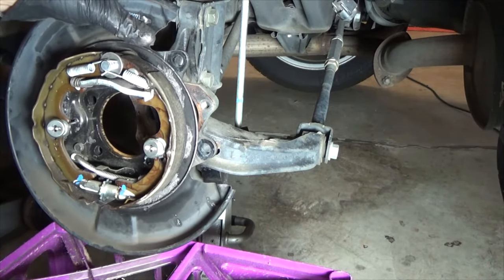It seems like a Daddy Longlegs there didn't realize the tape was very sticky. What I decided to do is use this very strong tape — it's very sticky, with high strength in the adhesive on the back — and I'm going to use that in place of lubricant like anti-seize. The book calls for anti-seize on the humps on this plate and metal-to-metal contact has lubricant. I chose to tape it over.